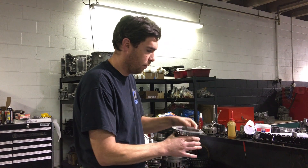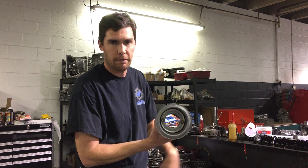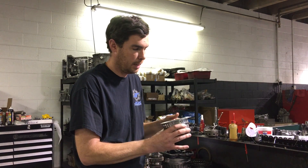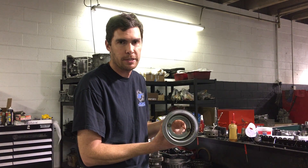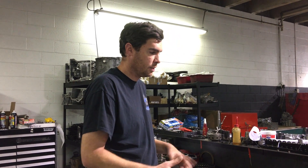We also make one for the B seal as well — just a sleeve. Press it in there, tack welded in there just to be safe. It doesn't need to be tack welded in but we do it to be safe. These seals really change the game as far as affordability is concerned with these transmissions, and we try to include these in every build from the FBO trans we have all the way up to the 1700.